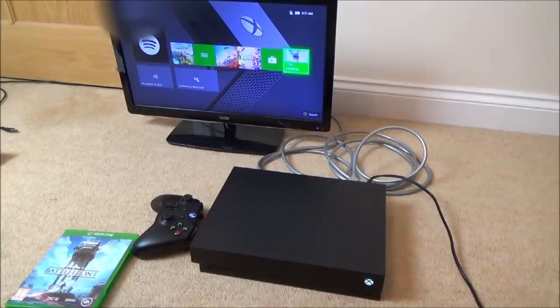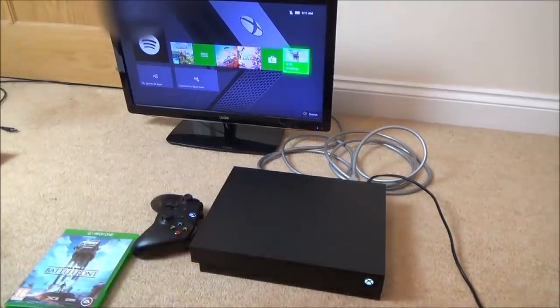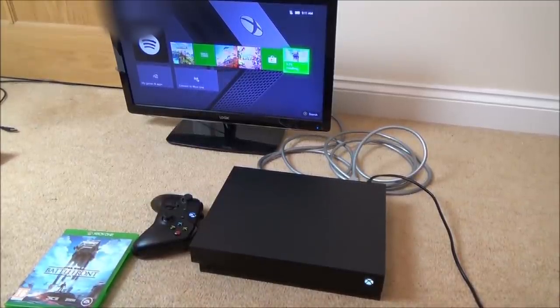Well, no, I think I was at 7 out of 8 and 480 degrees Celsius, and my hand was getting hot. I was holding the wand over it for so long, my hand felt like it was burning, and the board was still just getting all that heat away. So fair play to the board for doing what it's doing very well. There must be a lot of ground planes in there which is drawing all that heat away.